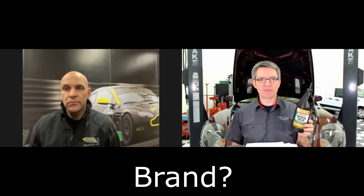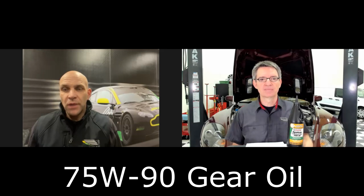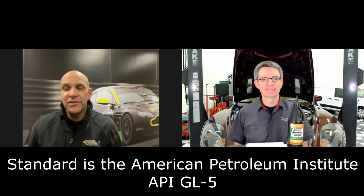So what if I'm in a market where I can't track down the Castrol, someplace in the world where it's just not available? What would you do in that situation? Well, it's 75W90, and any high pressure 75W90, especially if they talk about it being really good for limited slip differentials, then that's going to be good. Obviously, it's going to be of a decent enough price and brand to meet the standard, and that's what's important with any fluid or lube. Does it meet the fundamental standard requirements? If it does, then that's good to go.